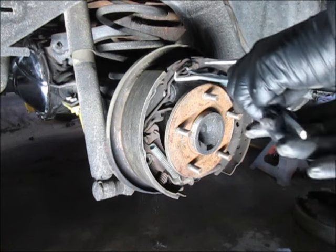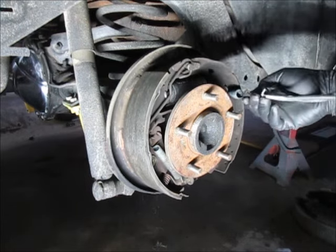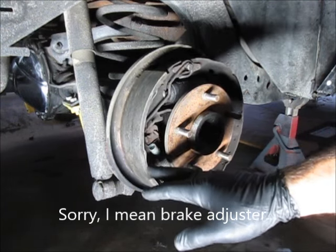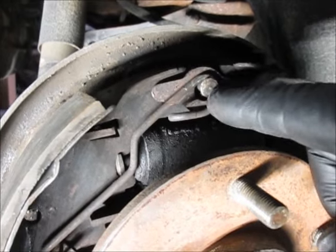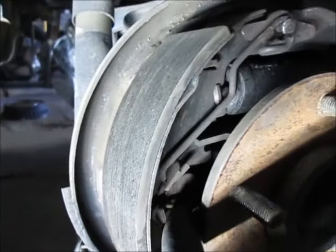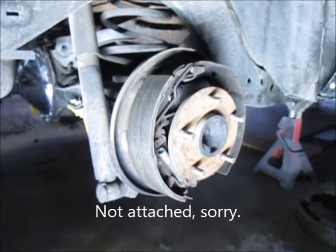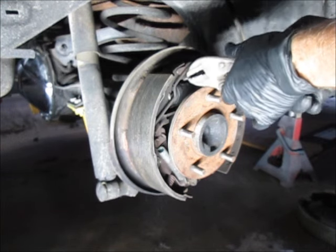There's the right side spring off. This part goes onto the parking brake assembly down here and it has a bunch of pieces to it. You've got the main arm which hooks around the post, and then that hooks to this little plate, which is then hooked into this bigger plate, which is then attached to the cable that connects to the parking brake. I'm going to grab this with my vise grips just because it's easier to get a hold of. Again, lay things out the way they come off.